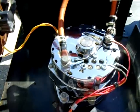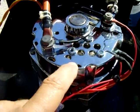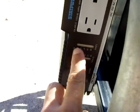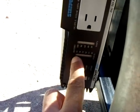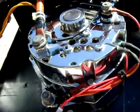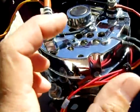Another alternator modification here. My voltage regulator was starting to go on me — I noticed my voltage on the meter was flickering around 15.5, even going into the red at 16. I've had this for about two years and use the machine a lot. The regulator for the 10SI and 12SI is a little small.